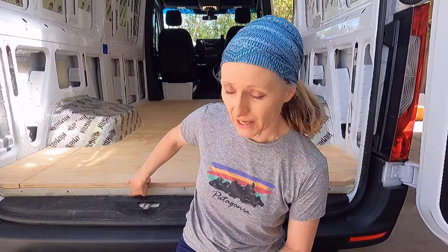In between the clear coating I ended up having to drive about three and a half hours each direction to pack up and move out of my old apartment — it got me to test it out. A few things were fantastic: nothing squeaks. I've got a good 150 brad nails in the top, it's been glued to the frame, and the frame's been glued to the van — everything cured properly. When you're gluing your subfloor to the van base, let it cure, because as soon as you put something on top and start attaching things to the frame it's going to want to pull it up from what it's adhered to. If you don't let it dry you're going to pull it up and start getting squeaks.